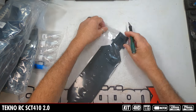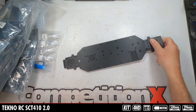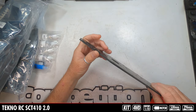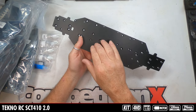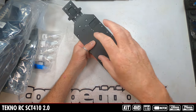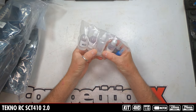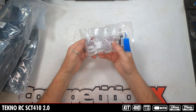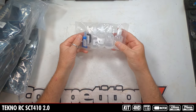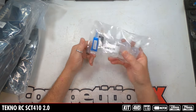Next we're going to look at the chassis. This is a four millimeter, long wear black anodized chassis. It's nice and thick with lots of large countersunk holes. Beautiful chassis — this is the base plate everything mounts to. Then we have the oils. We got 600, 700 — six and seven are probably for the shocks — and 10,000 and 15,000 for the diffs. There's also black grease and threadlock. Nice that they include all that; you can hang on to the leftovers for rebuilds.